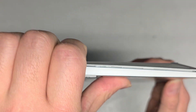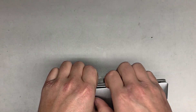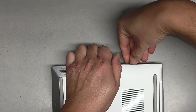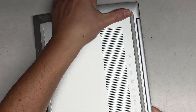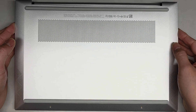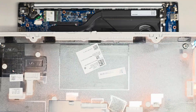You can see the gap popped all the way over. Once you've got the sides popped, you continue popping this out. Push this side down to flex the case — push down with your thumb to flex it in, and you can see how easily it pops up. You might have to use a pry tool again or your fingernails. Once it's all popped up, you can pull it up and it should unclip.